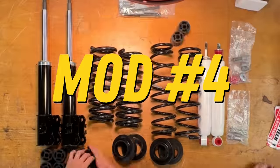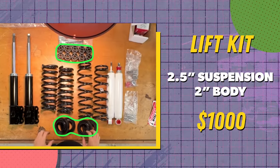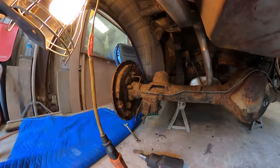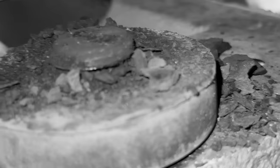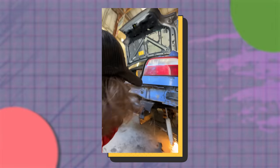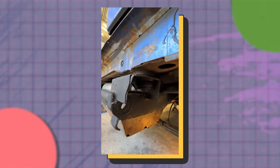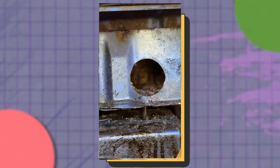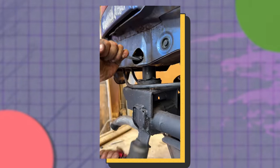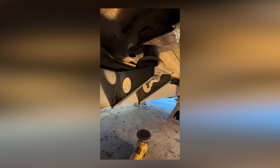I head down to Florida to meet up with my friend Blaine to install a $1,000 lift kit. The kit consists of a two-and-a-half-inch suspension lift and a two-inch body lift — four and a half inches total. The suspension install is fairly easy: remove the old shocks, springs, and struts and bolt in the new ones. But if you thought the rust issues were over, you've got another thing coming — more rust. As we go to remove the first body mount, the stud just breaks loose because it's so damn rusty. We took the bumper off to get access, sawzalled the bolt straight out, cut a little hole, and made a new body mount — and discovered what I think was a rat's nest. You just got evicted. The rear body mounts are solid; the front lift goes in no problem. The passenger side is hanging on by a thread, so we fabricate at least one more body mount, ending up with a new driver's side body mount with some gorgeous welding by Blaine.